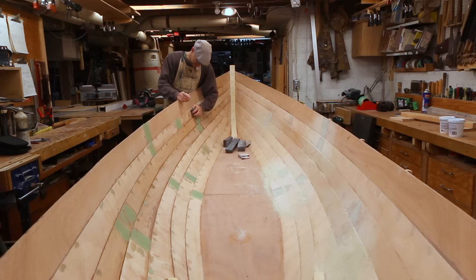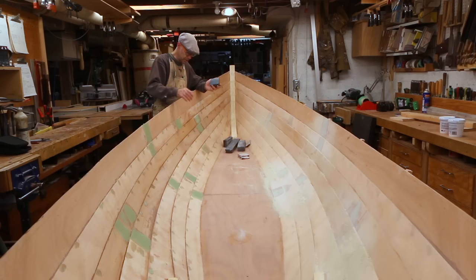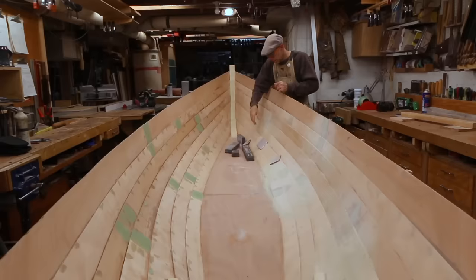You still need the 24 hours curing time on this stuff, so there's that inconvenience. What you can do, if you have little spots that you'd like to be able to hit with Bondo, you get a coat of paint on it first, and then you come at it with your Bondo to touch up here and there.